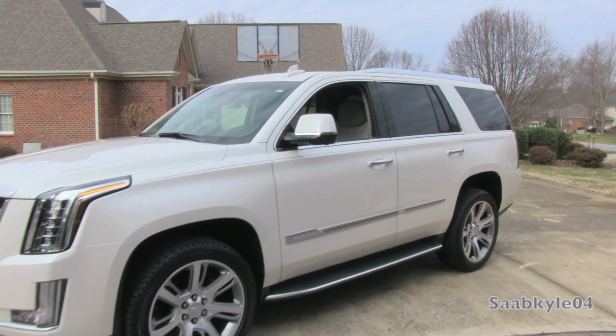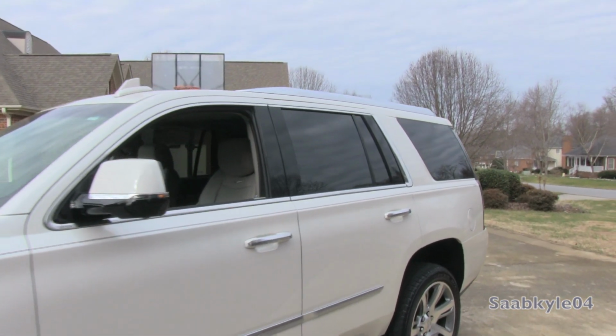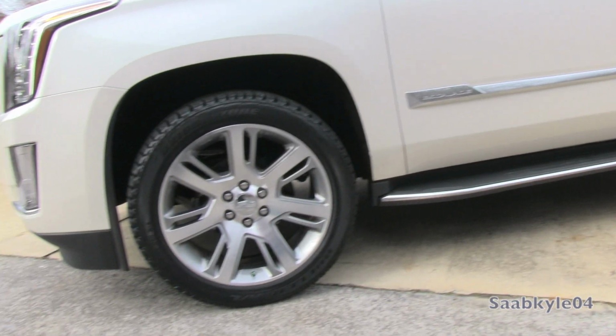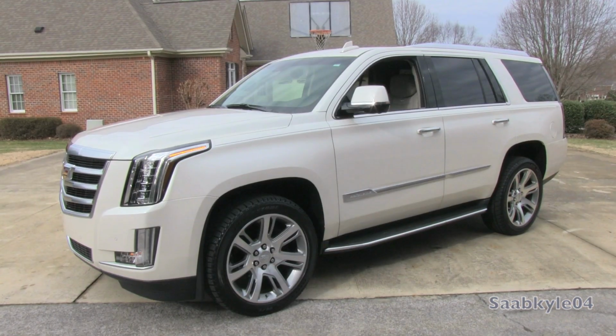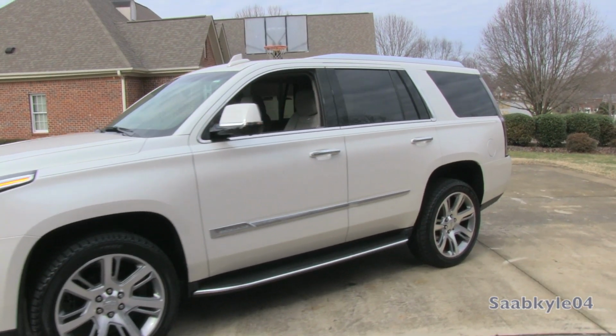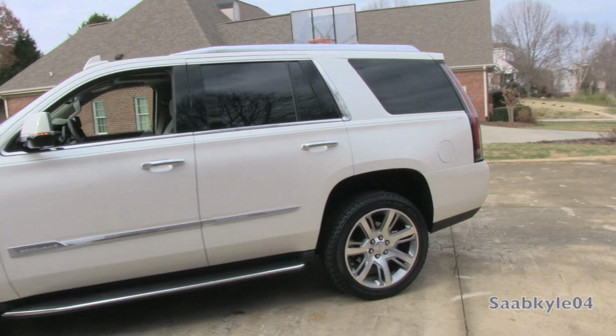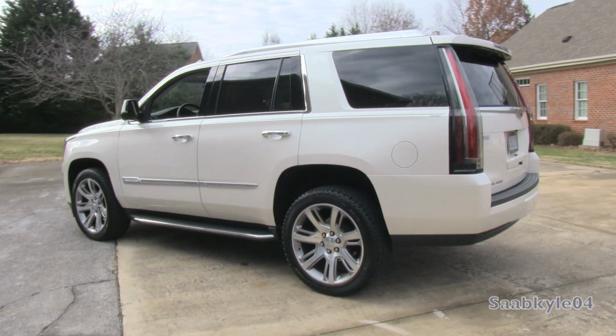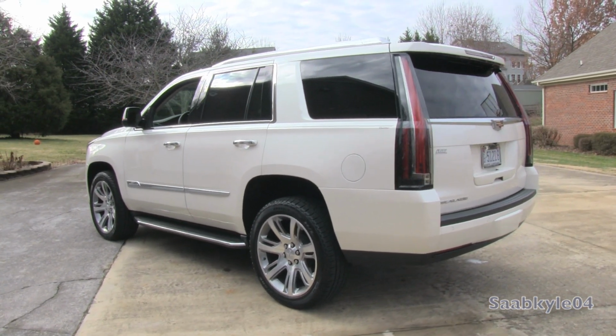The new Escalade, like its corporate stablemates, is built using traditional body-on-frame construction. The powertrain is bolted to a fully boxed frame composed of more than 75% high-strength steel. The benefit? Having the ability to tow upwards of 8,300 pounds and hold a payload of just over 1,500 pounds depending on wheelbase and drivetrain.